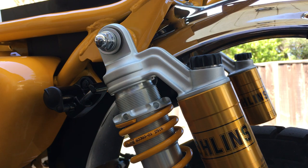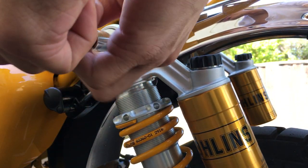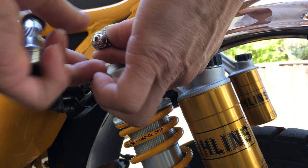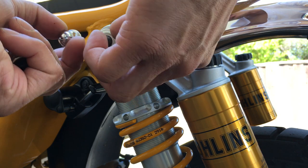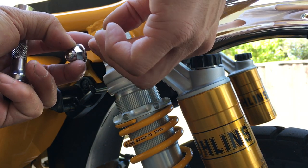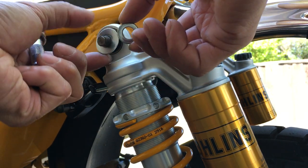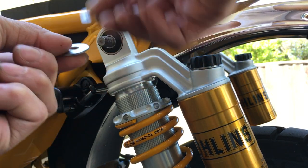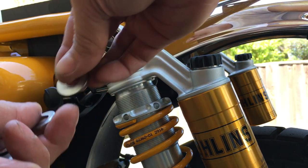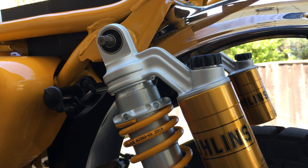Let's get that muffler side out. Let's get the clutch side - clutch lever or shifter side, I should say. So that's the acorn nut or the cap nut. That's the small washer, small washer, small washer, then large washer. We're going to put the rack on and we won't use the small washer because the rack is going to take the space of the small washer. So we're going to reuse the big one.